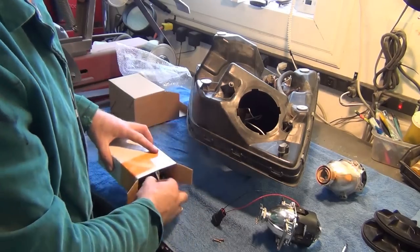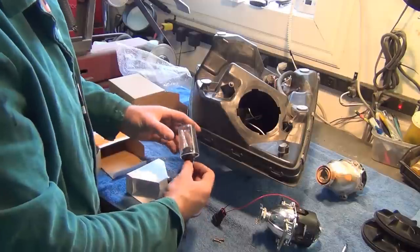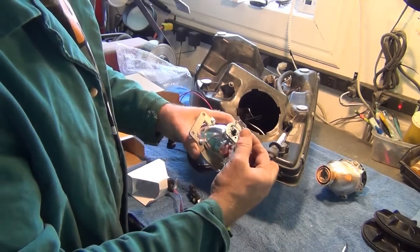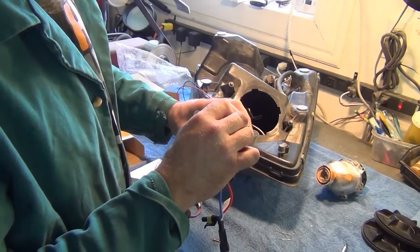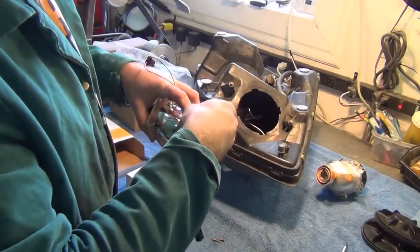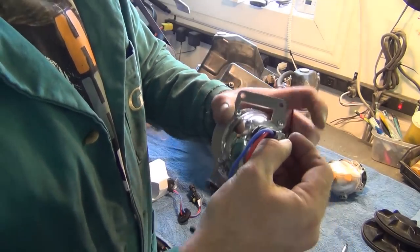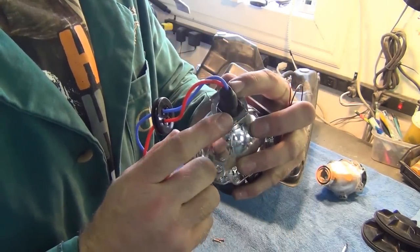So here's the container of bulbs. You want to be careful that you don't touch the bulbs themselves. So they come in a little protective plastic case. Take off this foam piece. And take this clip completely off. We'll need that in a moment. And be careful, again, not to touch the bulb. Slide it in, and we're going to replace this clip. So put the open ends through the holes, and then the spring clip slides in under there.